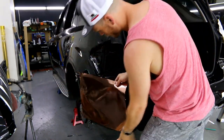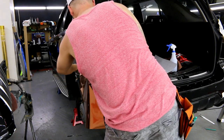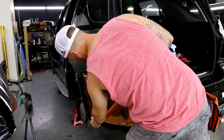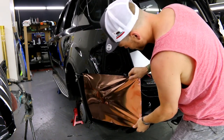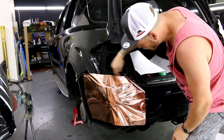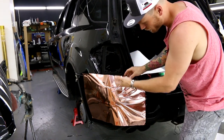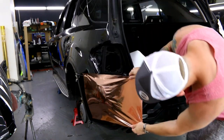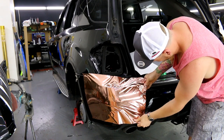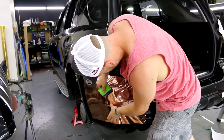I'm going to take my vinyl and blast it out. We're just going to pretend I'm wrapping the bumper. As you can see, if I pull in here at the top I get a lot of slack. If I'm doing chrome, the difficult part is right here — if I don't pull across enough, we have a lot of slack and if we try to stretch that slack up, it's not going to work because we'll end up over-stretching the film and breaking the finish. I do have to stretch it a bit more, but there will be greater limitations with a film like this.